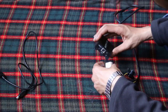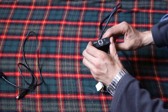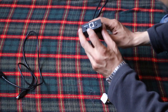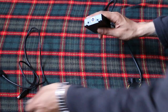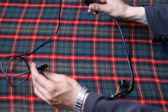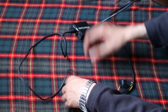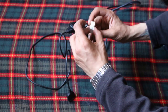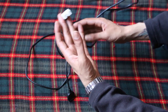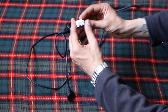I'll make a video of both installations. This CarLinks is a bit different to the original iPod connector for the Honda Accord — it's got an Aux/iPod connector, this one here, which would just plug in like this. You'd keep it in your glove box or some storage in your car for easy access, and then this other wire goes to the back of the head unit itself — not into the DVD player, but into an empty socket at the back of the head unit.